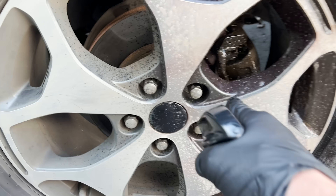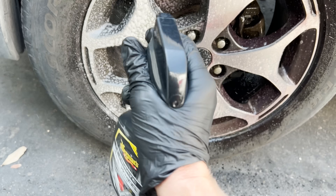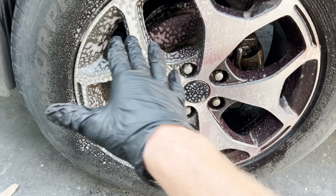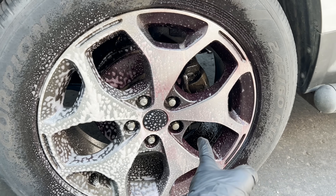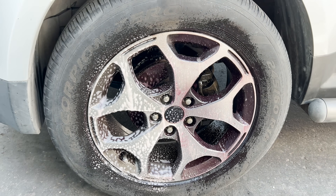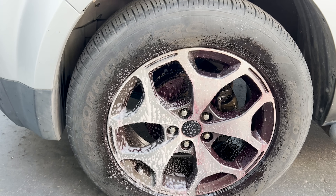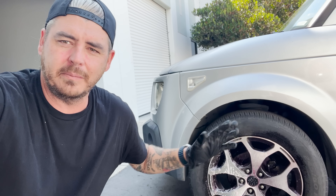You can see some purple starting to turn here — tons of it, really lighting up. Let's go ahead and spray the Ultimate Wheel Cleaner on the other side. This one does a good job of coverage and sticking onto the surface, but it's a little more foamy versus the Chemical Guys side which is more gel-like. Both of them are doing a good job of staying on the surface. The Chemical Guys side is having a lot of purple reaction; the Meguiar's side is definitely starting to as well. If I was to say one was reacting more, I would say the Chemical Guys is working more — it may just have a higher concentration of the active ingredient. We're going to let this dwell and not let it dry onto the surface, but give it enough time to penetrate and break everything down, then simply rinse it off with the pressure washer.